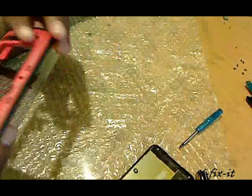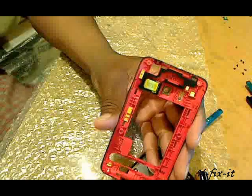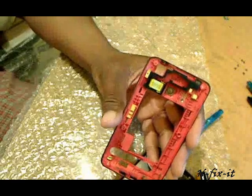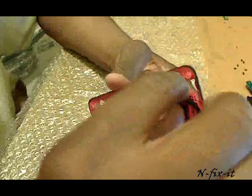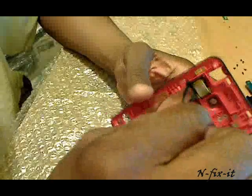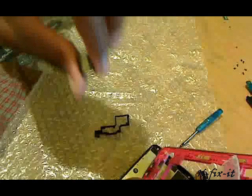Then you have your rear case. The only other thing to remove is the rear speaker — we're going to go through that process right now. Once you have disconnected everything, you can see the rear case. You're going to take out the outer rubber shell, then put your tool in from the back at the top, and you can see the speaker just pops out.